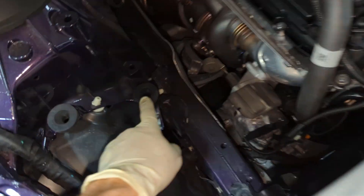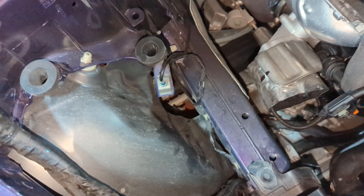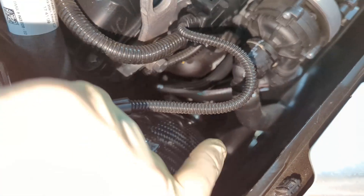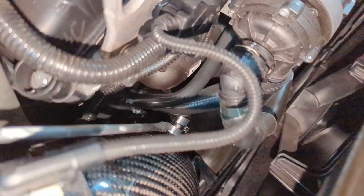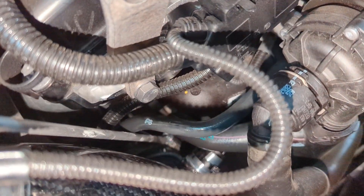The new air box fits into the existing grommets on the frame. The secondary air intake should go between the frame and the fender. The most important thing is to get that secondary air intake to slide in between the frame and the wheel well first, then clip into the grommets once that's in. Don't forget to clip on your PCV line right down here — just push it onto the existing attachment. Then tighten that clamp from this angle.